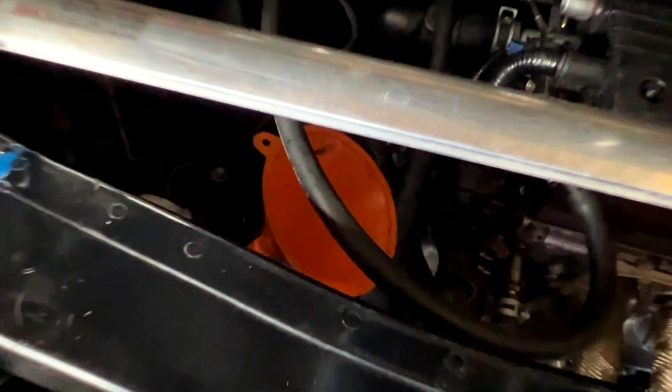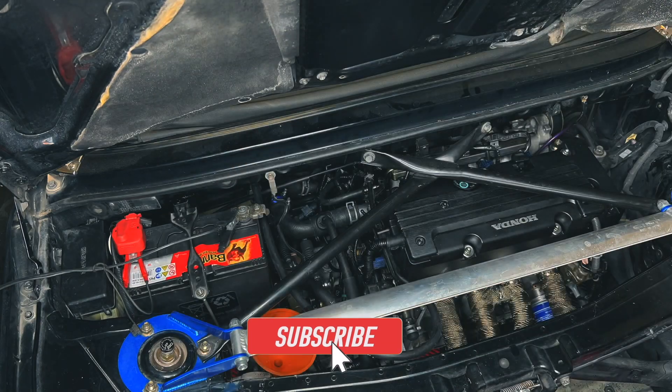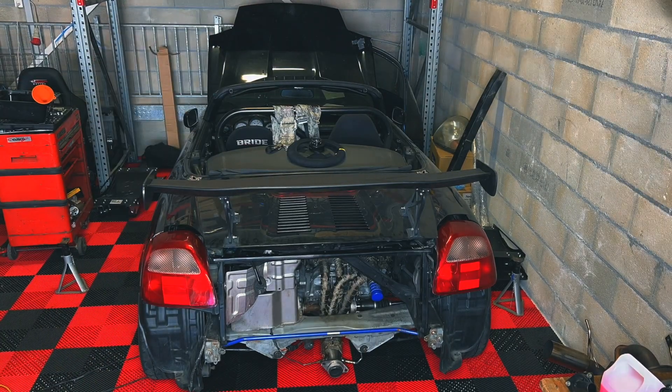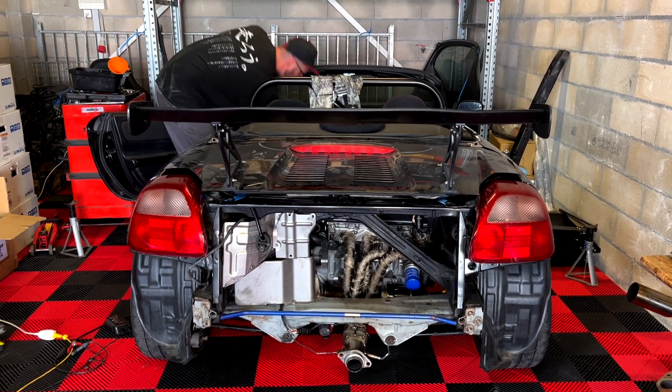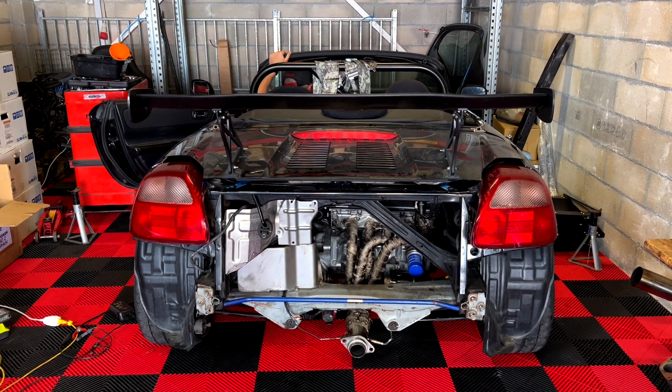A really important step — do not forget to fill up the oil. I hooked up a garden hose to a funnel that I put in the upper filling hole of the transmission, which allows me very easily to fill up the oil. Make sure to put a bucket below to catch any excess. That worked out pretty well. Now I'm going to be putting the car back on its wheels for the first time in a really long time — I think at least six months since the car was on jack stands — and I'm super stoked about that.